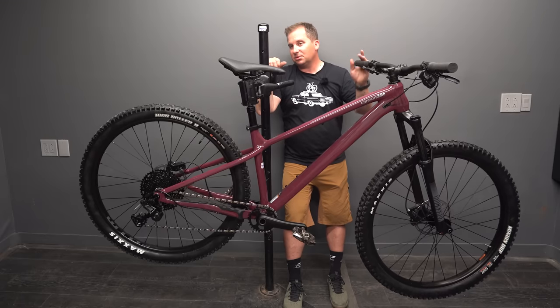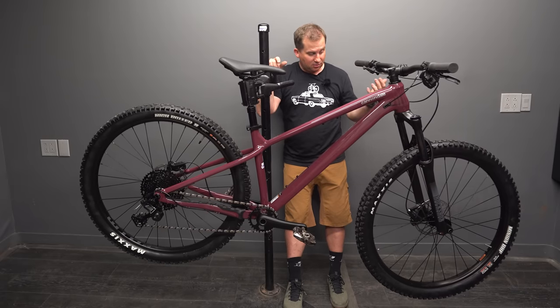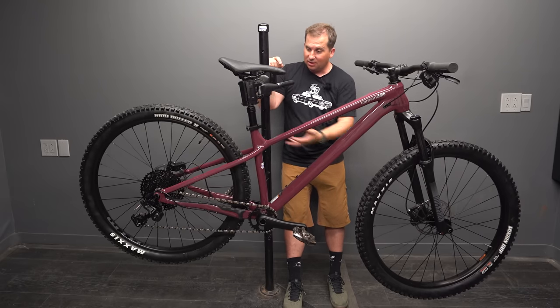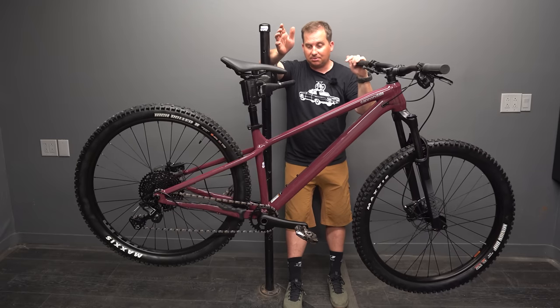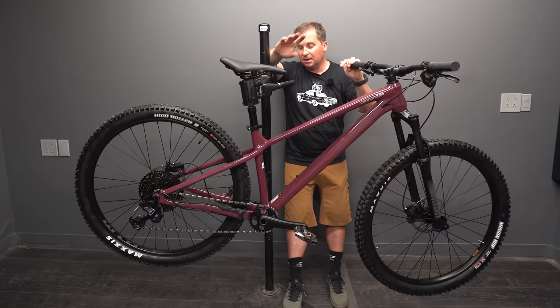But, I mean, there's some really good stuff going on. Really great tires. Great 30i rims. We've got the 165 mil cranks, the great Advent X drivetrain. So really, apart from dropper and fork, I don't feel like anything else needs to be upgraded on this. And to be honest, this still might be fine for most people. We'll see in the ride review.